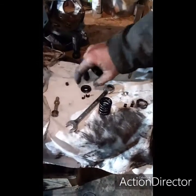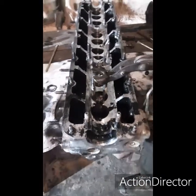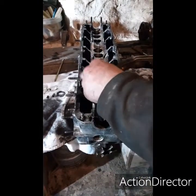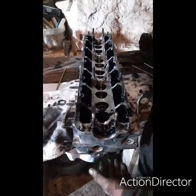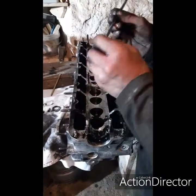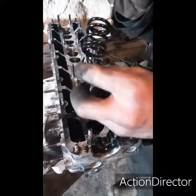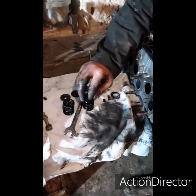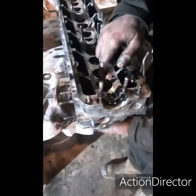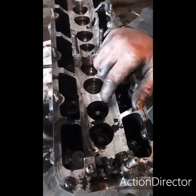You don't really need to for them, but I tend to keep them sort of in order. Then we release, take the jiggery pokery out. Then magnet on the top, get the top. Then take the little valve spring out, quite a cute little valve spring, and the big doer of a valve spring. So there we go, look at them two, lovely. Not usually that they have double valve springs. And then, so you can actually see that valve there.